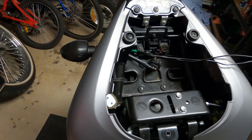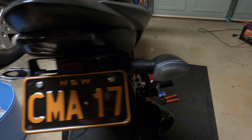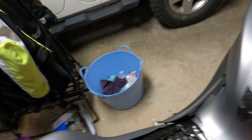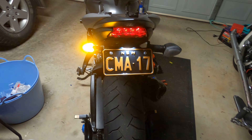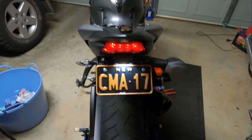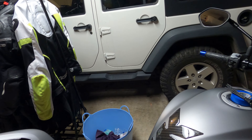Anyway, I'm going to do these joins and hopefully we'll come back and she's working. LED light number one is on. About to hit the second one just to show you what the hyper flash looks like — turning on left indicator now. And that's the hyper flash. Easy fix, all you need is that relay.